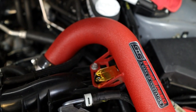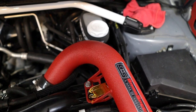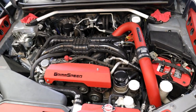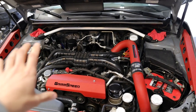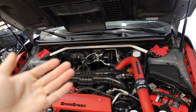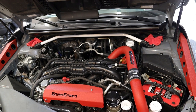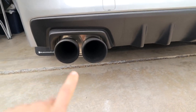I also have the flex fuel kit. I wrapped that sensor in gold foil to protect it from heat — some of the older versions were failing due to overheating. I have the upgraded version and have been running it for more than a year, even on 110-degree days, with zero issues. I'm able to run up to an E65 blend. For the fuel system, I did not need to upgrade the fuel lines. The only thing required is a drop-in low pressure fuel pump in the gas tank — I have the DeatschWerks 65C, which my tuner recommended. It's not too noisy and has worked beautifully.